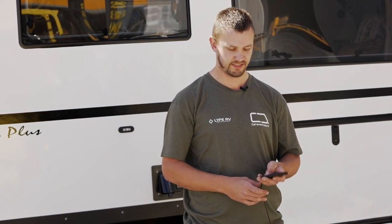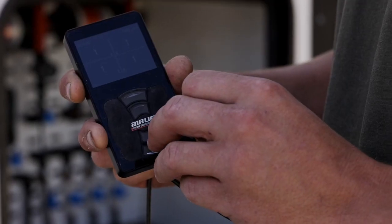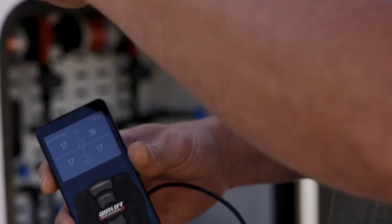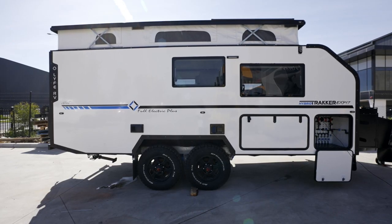With the ALP3 system, we've got preset heights with the auto level. At the moment, the van is aired out at its minimum level. By pushing the control button in the centre three times, we air the van up to a highway ride height. The van is now sitting at a height that would be good for travelling down the highway behind the car.